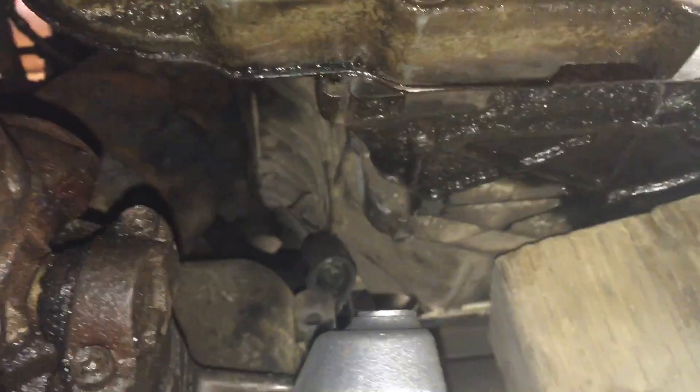I jacked it up on the driver side and jacked up the motor just a little bit to give it a little clearance. I need the solenoid facing forward and it should roll right through there — otherwise there's not quite enough clearance and you might break the starter.